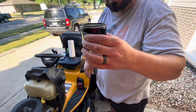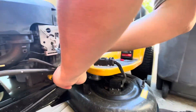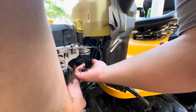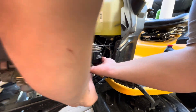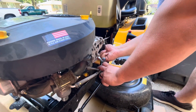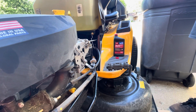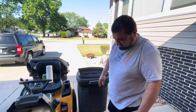So we lubed up the ring — put some oil around the ring of the oil filter. You know me, the lube king. And then we'll just put it right on here, obviously just hand tight, about three quarters of a turn after it hits the base. Nice base. Good base. And we've got the oil filter on there. The next step is just put about a quart, a little bit more than a half a quart in there, and then we'll see where the levels are.